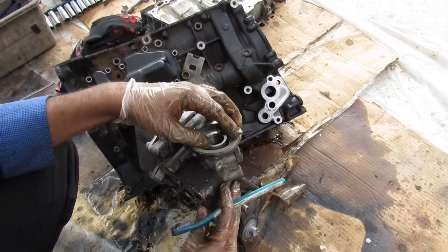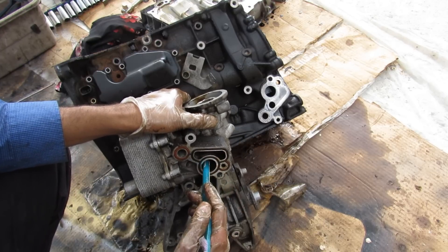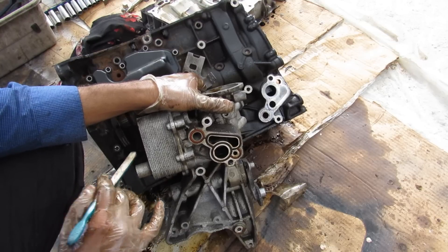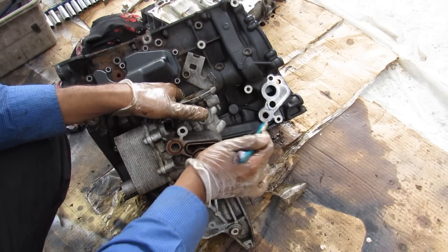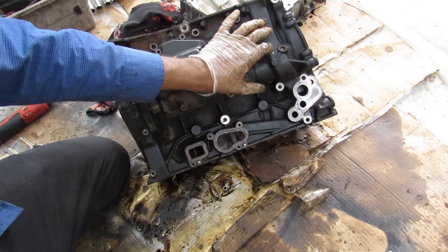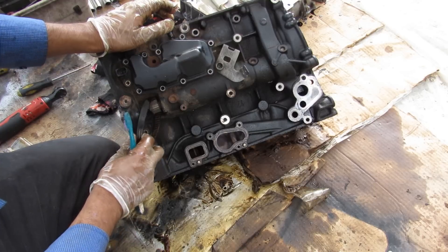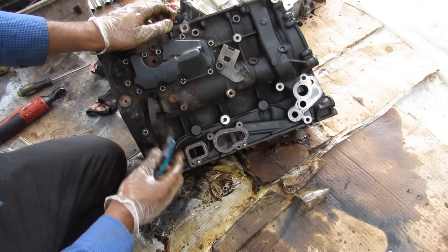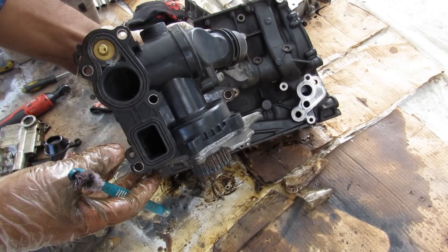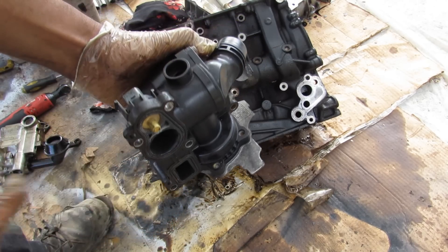The oil filter bolts onto the top of the assembly, making it easy to access from the top of the engine. Once filtered, the oil is sent back through ports and into the block for circulation. The water pump also sends coolant back into the engine through two other holes straight into the coolant jacket. At the front of the engine, a cylinder houses the balance shaft, and the end of the balance shaft drives the water pump via a small rubber belt. You've also got your water inlet and outlet connecting to the pump and thermostat assembly — and as mentioned, this thermostat and water pump assembly can be quite troublesome, so upgrading to the metal version is recommended.